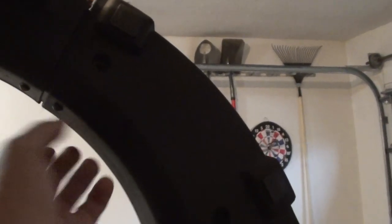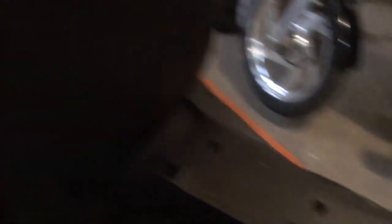You have to watch for the little clips that the outside window connects to. I would wait and pull all of this off at once. This broken section popped right out with no problem; the other side is in pretty well. I would wait and get the top section because every one of these sections when you pull away, the outside plastic attached looks like it's going to pull off. The next section has six bolts: three across each side, plus one extra that I'm not sure does anything.